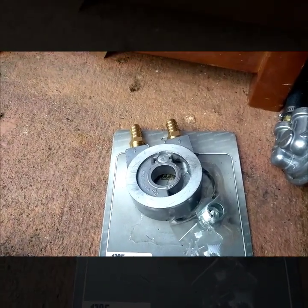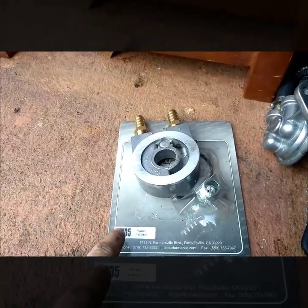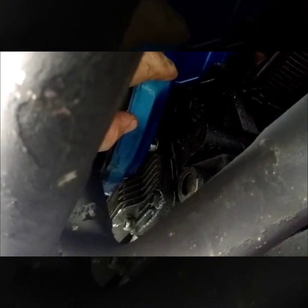Welcome to math. Worst way to add an oil cooler — we're going to rig this up. There are several ways to add an oil cooler to a Volkswagen; probably the best way is to correctly full-flow your engine case. We already have a filter pump, and they make a cover to convert it into a full-flow cover. But I don't want to have to take my engine tins off, pull the pulley off, pull the cover off, put a new gasket on, and go through all that. I want to do this the easy way — it's not the best way, but it should work.